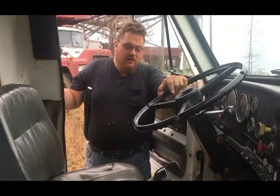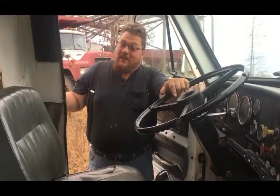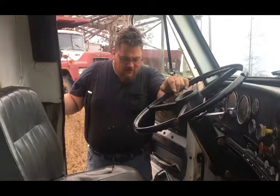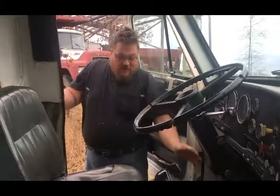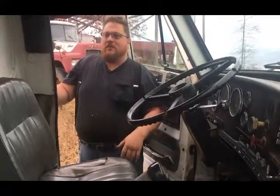There may also be a possibility of making this either an extended cab or a crew cab while we're doing the floor work. I'm still looking into cab parts, but since I'm taking the cab off anyway I may shoot for an extended cab, which would be kind of an interesting truck since none of these ever came out that way. We'll see what comes of finding spare doors and all that, but we're definitely going to do the bracing before we cut the floor out so everything stays right for the doors. Alright, see you.